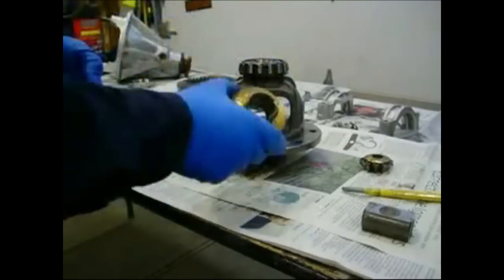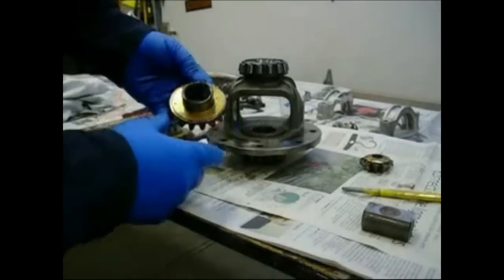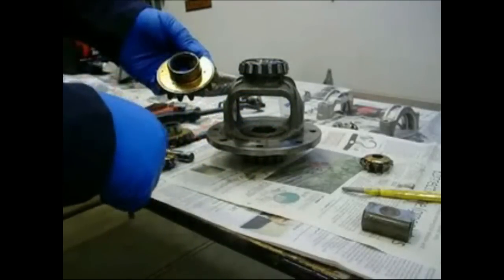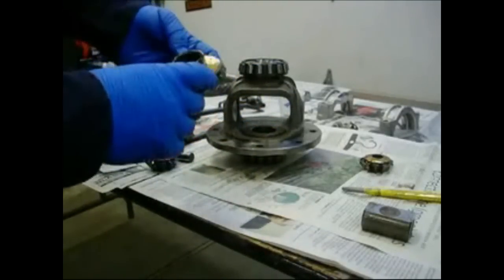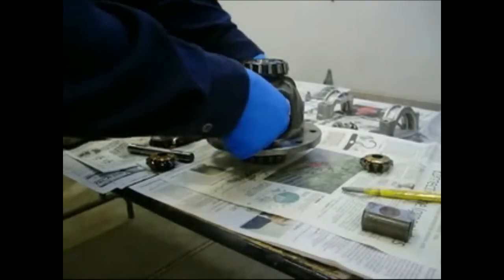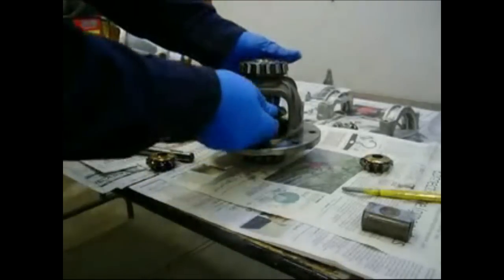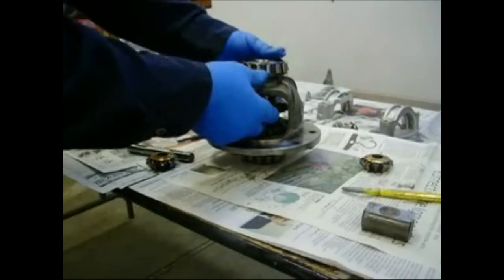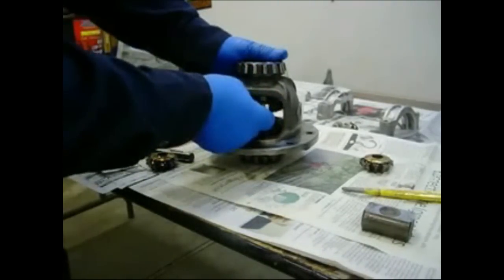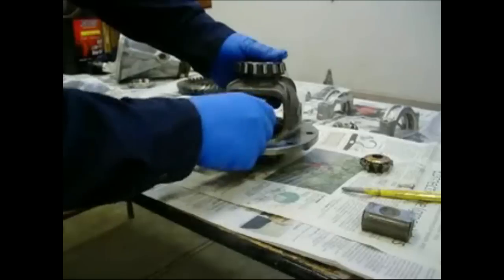So now I've got everything prepped and lubricated. I've cleaned everything. Took an epoxy brush and 90-weight gear lube so I didn't have to just soak it in it. And the spider gears, one goes in right there. The other one, got to stick in and tuck it up inside here. Tolerances are kind of tight, so get them close, they go in. So now what I found, this isn't the first take, what I found is you hold the one gear in there.